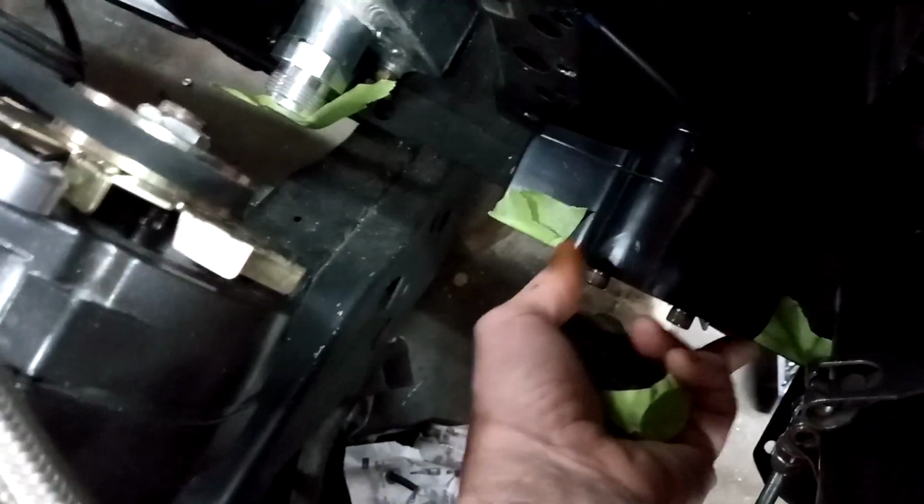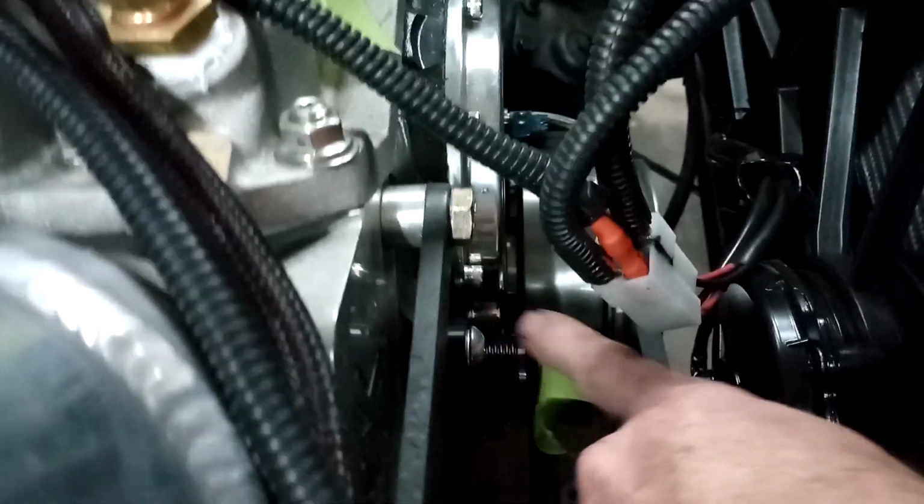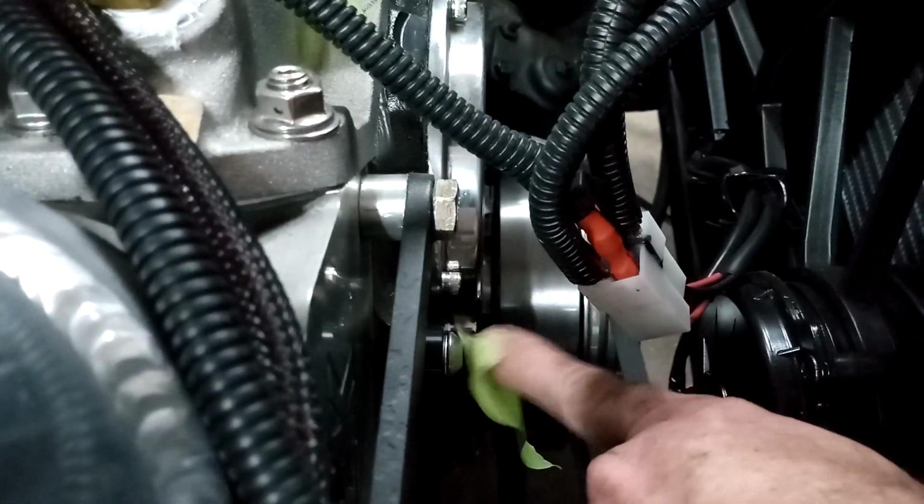But I've got a shorter fitting to go in there, 1-inch pipe to -16. I've got the two O-ring fittings to come out -16. Will come out of the radiator into the feed. Out of here, these I will snake through and either go behind and under the alternator and behind the belt, over to these two -16 fittings going into the block. Will come out of there into here. The -10 stuff will run out here to the little radiator. Get the breather lines put on it.